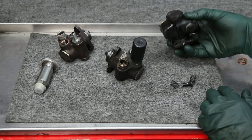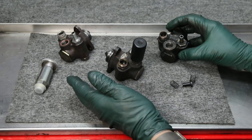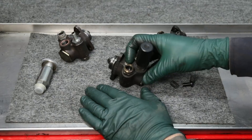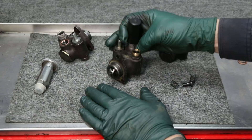I've been taking these apart, looking them over, and seeing the wear problems. If your lift pump starts to go bad, you'll have some weird things happening — maybe a power problem, it doesn't want to accelerate or doesn't go as fast as it used to. You've tried changing your fuel filters and it didn't improve. When this pump starts to wear out, pressure to the injection pump drops, and with reduced pressure you'll have a loss of power and possibly hard starting.